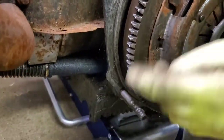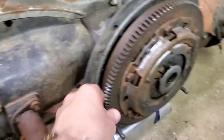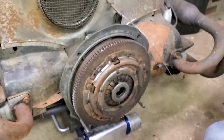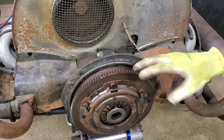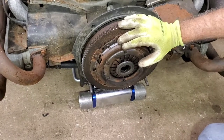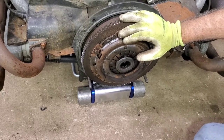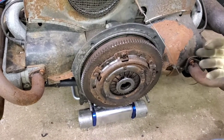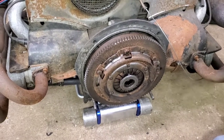The edge is all chewed up — it got stuck or didn't spin at some point and just ate the crap out of the flywheel. You really don't want to mix those up. How he got away with this: it was a 12-volt engine, he had a 6-volt starter on there, and a 6-volt flywheel, so the teeth would mesh correctly and it would spin. If you run 12 volts to a 6-volt starter, you can crank it for a while, but you don't want to crank it very long because it will burn that starter up. It'll spin it really fast and usually start the engine quickly, but it's not the greatest thing to do.